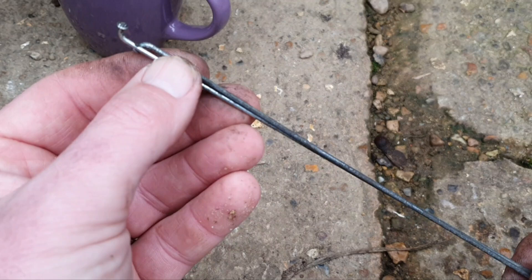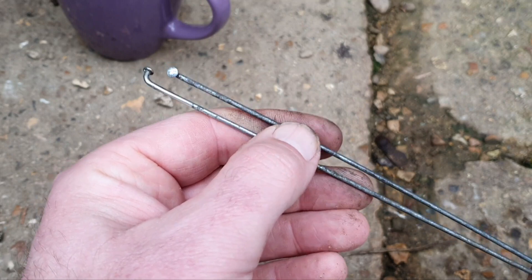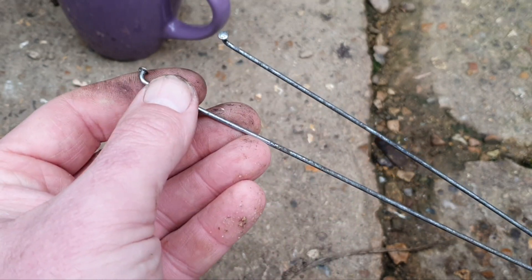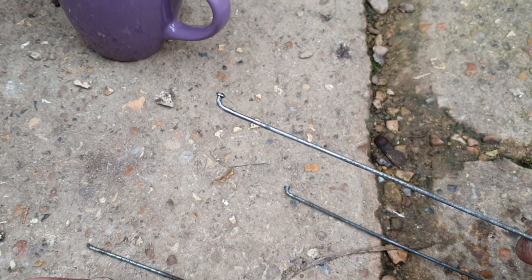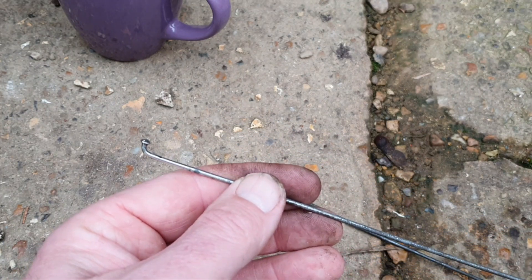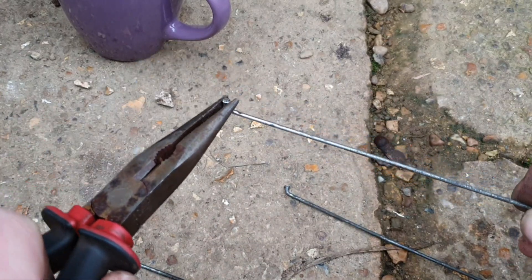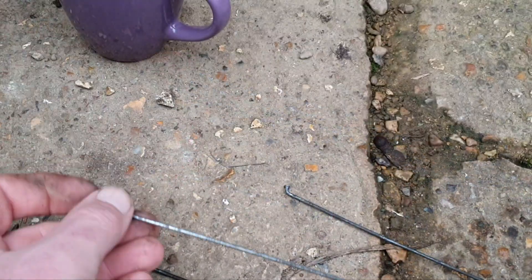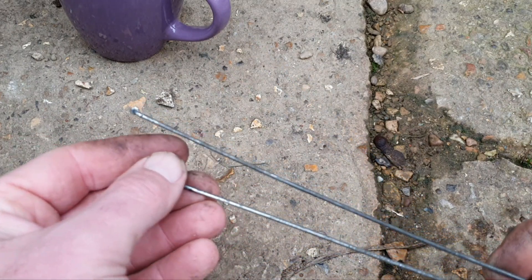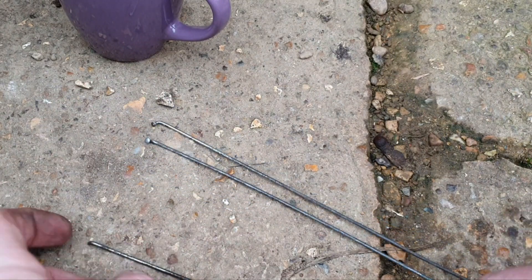The other type of spoke is called a pull-through - it's basically straight and just pulls through. They're sometimes very difficult to get; J-bends are more common. I heard of one guy on YouTube who was touring and a spoke broke, so he bought a J-bend, got a pair of pliers, straightened it out and used that. For that type of hub they recommend carrying a few spares in the handlebar of the bicycle, or in the seat post, a backpack, or a carrier.